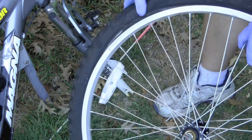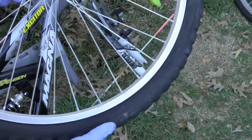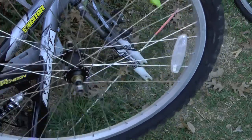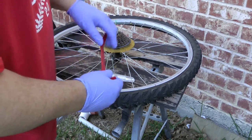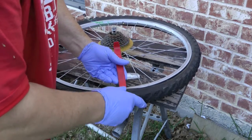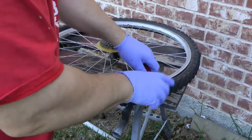I was able to squeeze that back in there. You can see the tire is a little split there. It's basically a plastic tool called a tire lever that you fish between here and force it in, but with all the air out it's pretty easy to maneuver. Get yourself a tire lever — or if you're like me and can't find yours, use a car trim remover. You basically want something plastic, not metal, although if you're really careful you could probably get away with a screwdriver. Just work it around until enough of it's over that you can do the rest by hand.